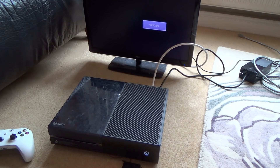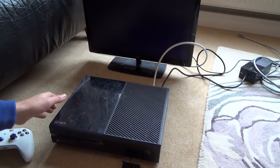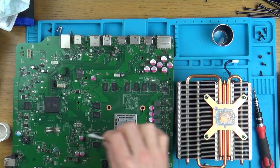Unless just unseating the hard drive and connecting it up again has fixed the issue — yeah, here we go, it wasn't doing this before. It's probably going to overheat though, because I took off the x-clamp and now the heat sink is just resting on it. Yeah, it's ramping up now. We'll let it cut off. There you go — it's overheated. I'm going to put the x-clamp back on and try again because I'm wondering if it's a hard drive issue. Let's get the x-clamp back on and put some new thermal paste on it.